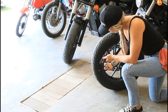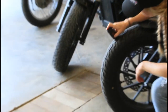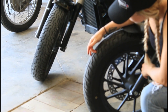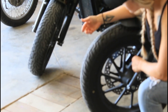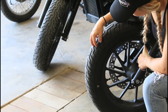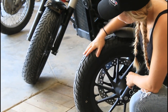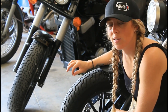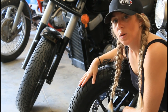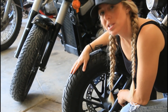To check your tire tread, this digital tool has a handy probe on the side — stick it in and it'll give you a digital reading of your tread depth. You also want to watch for wear indicator bars that sit between the tread grooves. When the tread wears down to those bars, you'll see markings that say either TWI or a small triangle. Once you reach that point, do not delay — get a new set of tires. We're riding on two tires, not four, so a blown tire at 75 mph on the highway is incredibly dangerous. Check your tires and check them often.